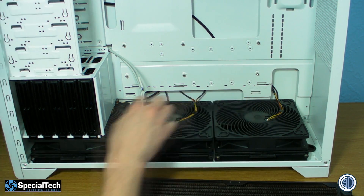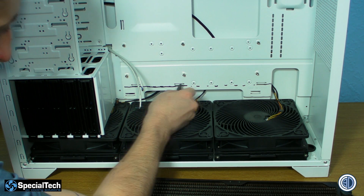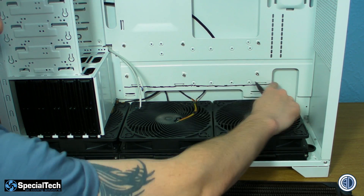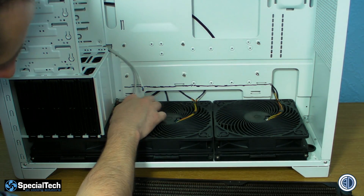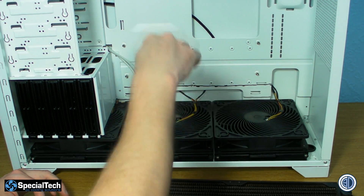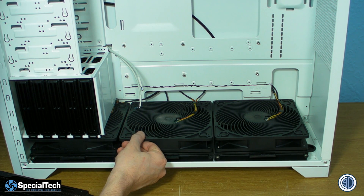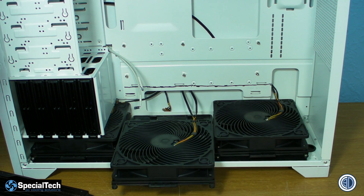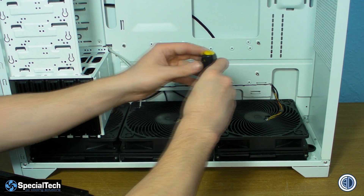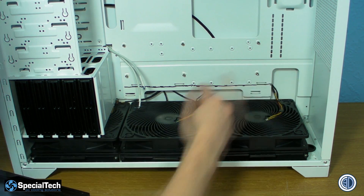So what we're going to do — have a look carefully, I've marked out these dotted lines, it's a bit rough but just to show you where I want to cut. There are some zip tie clamps and basically I want to cut along these zip tie clamp holes right the way across, then at the bottom we'll remove all of that. There's also a little clamp here behind the fans we'll remove as well. What we're going to do is essentially screw the radiator straight to the fans and then actually use the case mounting system — we'll be able to slide all of the fan and radiator in, in one place. Then all we need is two screws on each fan and it's fixed.